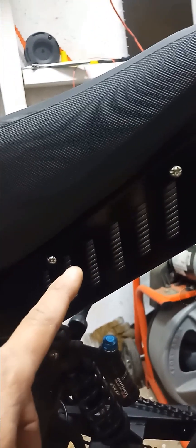I was aware of that, I just didn't know how this battery was made. When I took it apart, I learned that there's a BMS built into these batteries. BMS stands for Battery Management System. The BMS controls the discharge and the charging of the battery. The BMS built into this battery that came with the bike is rated at 150 amps. The speed controller software was set to draw 150 amps.